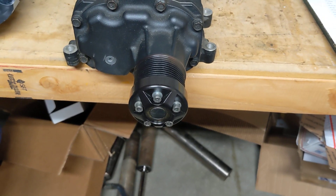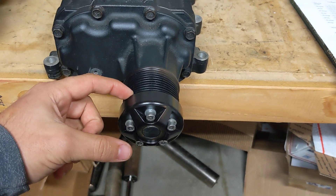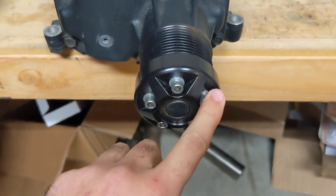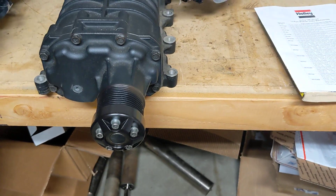The aftermarket underdriven pulley has a hub pressed onto the shaft and the pulley just bolts on and off. The belt drive is going to be in this area, so I'll actually need to take this pulley off, machine this star pattern off, and run it backwards so the belt will align with the accessory drive.